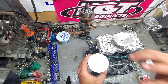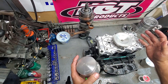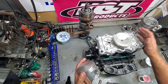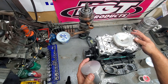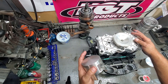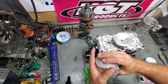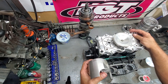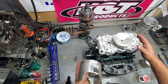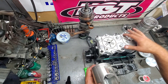Why this is important: you want it to be tight, but not too tight. Normally on a performance motor, you're anywhere between 35 and 65 thousandths in that neighborhood. It really depends on the size of the bore that you're running and also the stroke. The tighter you can get it the better — obviously to a point; get it too tight and bad things happen. On this type of motor, which is going to be raced, I shoot for right around 50.